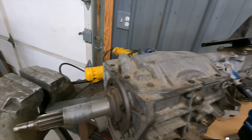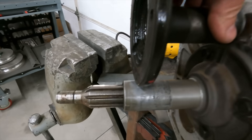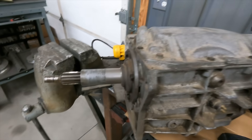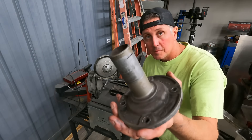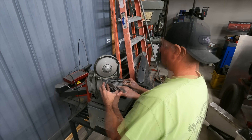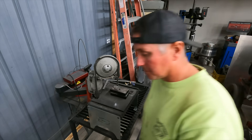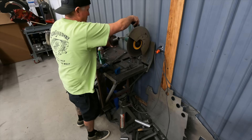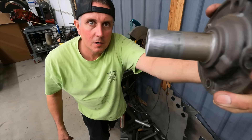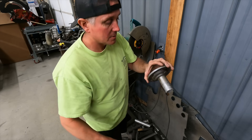The amount of snout stick-out on this one is more than the other and it will crash into the clutch disc, so I'm going to mark this one and cut a little bit off of it. I couldn't find a pipe cutter big enough so I'm going to use the bandsaw. I'll straighten that up and put it in the car. Perfect — nice and square. Looks good to me. I'll just hit it with a file real quick, then we'll bolt this back up to the transmission.